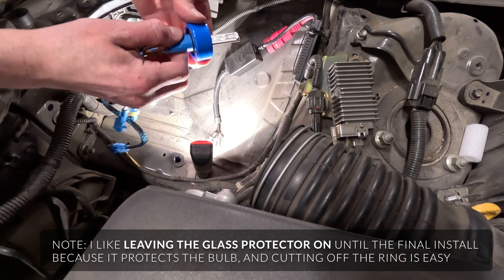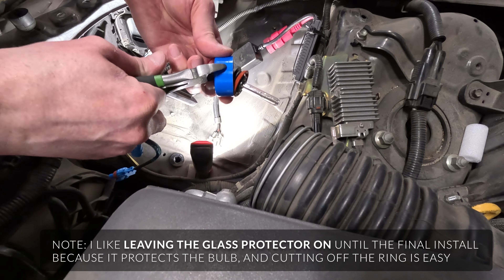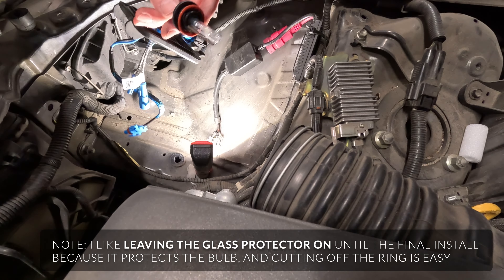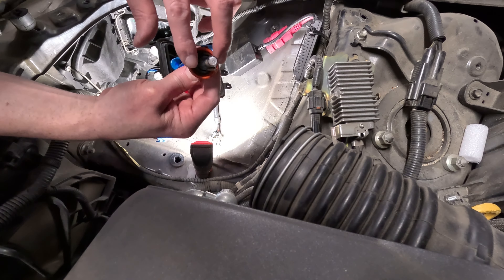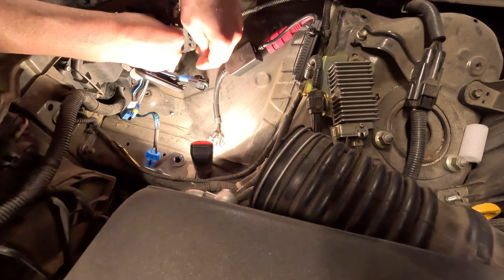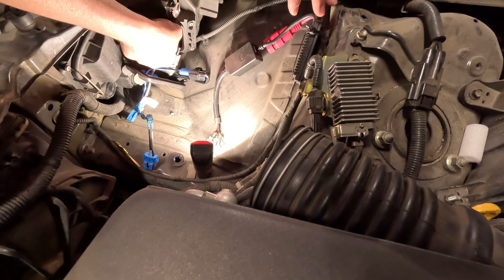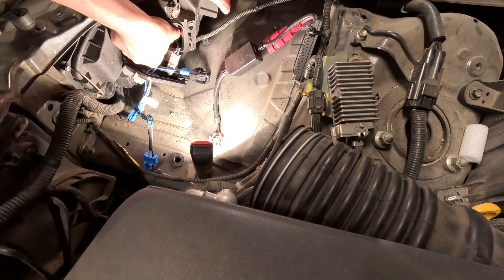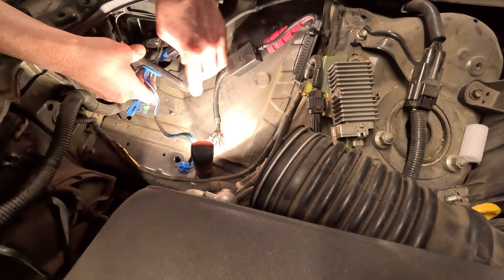This car is fairly simple. I just realized I accidentally forgot to remove the cap, so I'm going to cut it off with wire cutters. If this happens to you, don't fret — just break it off. Try not to touch the plastic housing though. There are three hooks — two are small and one is big, towards the front of the car on this side. Wiggle it a bit until you feel it line up, then twist clockwise about a quarter turn. It's difficult to reach in there. If you use pliers, be very careful how much tension you use or you'll break it. You'll eventually tuck all the slack back in, but test it first. It worked.